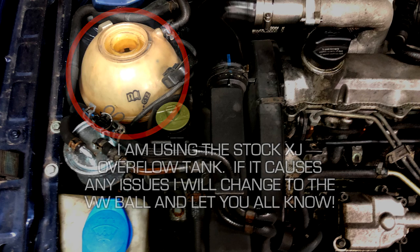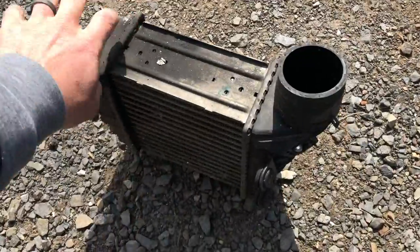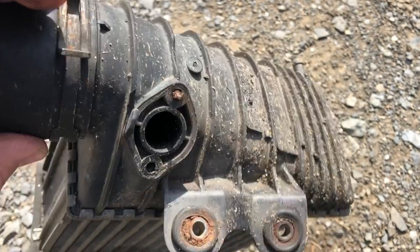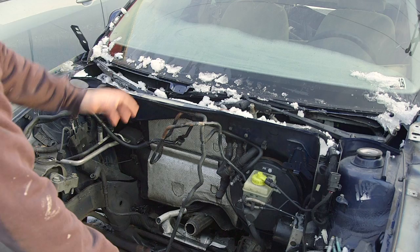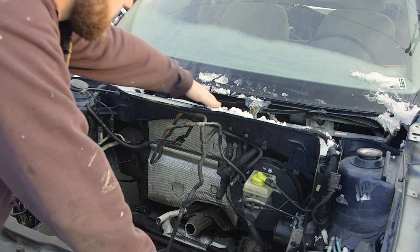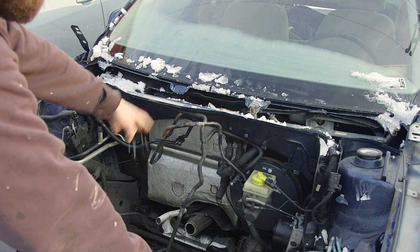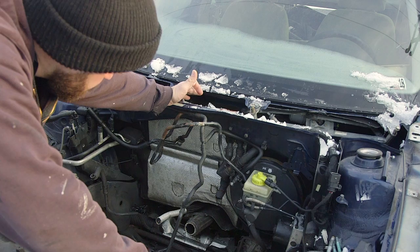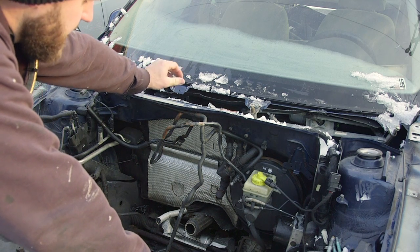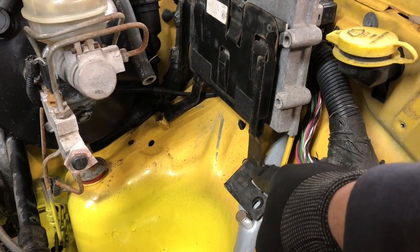That's definitely a good idea. There's some wiring harness that runs through here down to your intercooler and the MAP sensor that's on the intercooler, so you'll want to pull the whole intercooler and that. The fender's off here — you don't have to remove the fender to get to everything. Definitely want to take the hood off; that makes things easier. For your ECU, you'll need to pull the windshield wipers off — the ECU sits down right inside the center of your rain tray. There's a cowl cover under there, and then you can reach in, pop out the ECU and the two main harnesses that come off of it. Go ahead and pull the tray the ECU sits in because that's going to make mounting your ECU easier.